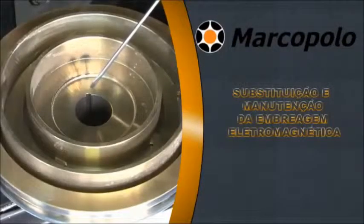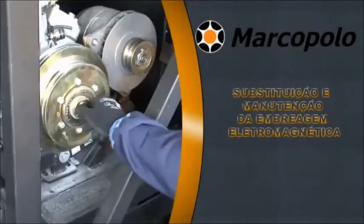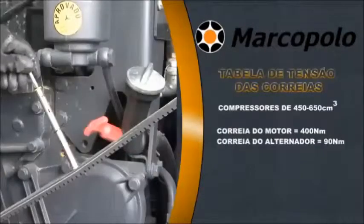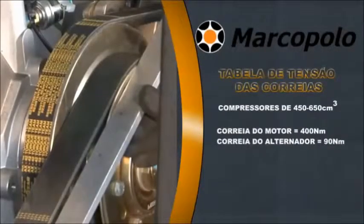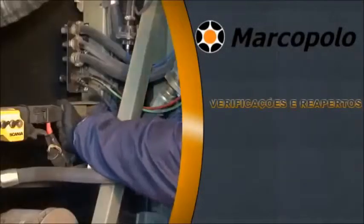Make sure that the assembly keyway matches with the compressor shaft key. Pick and place the clutch assembly into the vehicle compressor. Retighten the center nut and tighten the center bolt using the spanner and torque wrench. Reinstall the belt on the pulley and retighten. Check the proper belt tension using the recommended tensioning gauge. Check pulley alignment using a scale, and check all electrical connections.